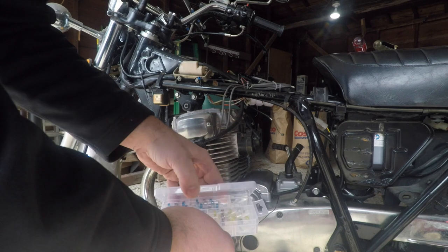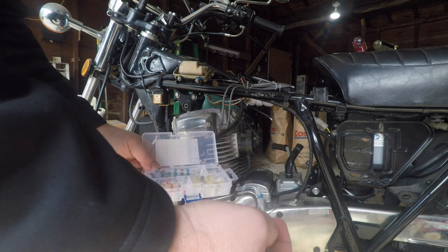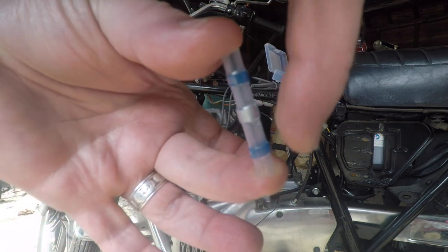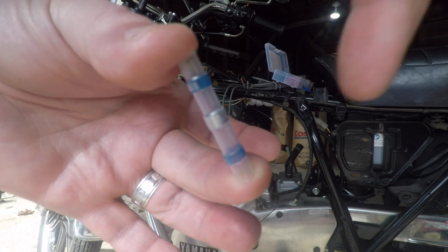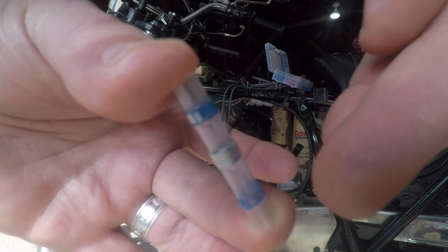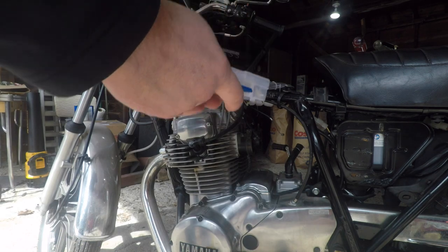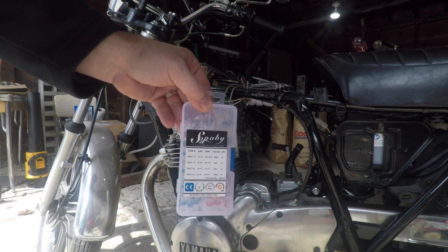So these are connectors for wiring, but they do a couple things. They have solder built into them here in the center. Let's see if we can get a better picture here. So there's solder in the middle there, and then you can seal up the wires against moisture from there. Basically what you do is you put your two wires in there, you use a heat gun, and you melt it all together. So the solder melts and it connects your wires, so you'll have a much better connection than just a crimp connection. And then, especially because it's a motorcycle, these will melt and this will help to seal your connections. I think this whole box was like $15, and it's some of the best $15 you'll ever spend. Again, I will put a link in the description for you.